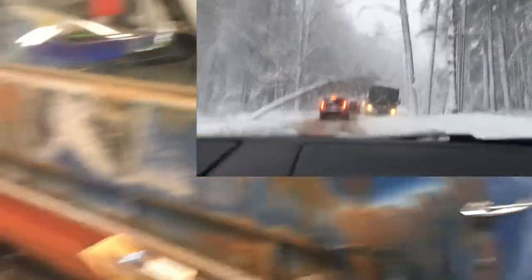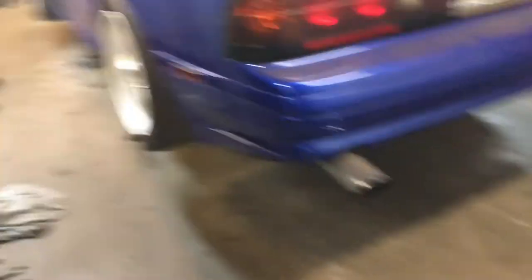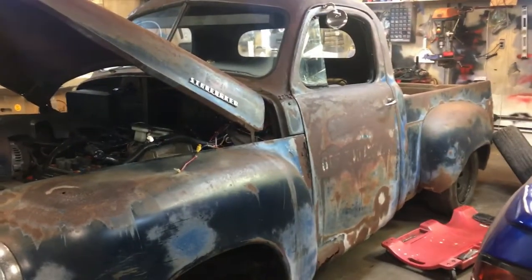We had a big winter storm and it's been two weeks since I tore the truck apart, but I finally got this piece of junk out of here. I got my spindles — here are the drop spindles for the Studebaker. I got the old spindles out. Springs are cut one inch for a one-inch drop, giving me three inches in the front; I already did the rear which is four. Getting the Studebaker mobile again is going to be a big step.